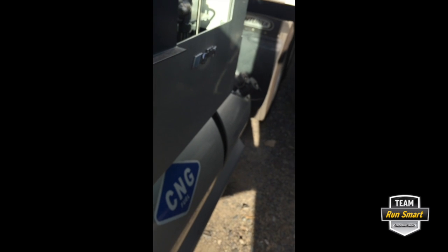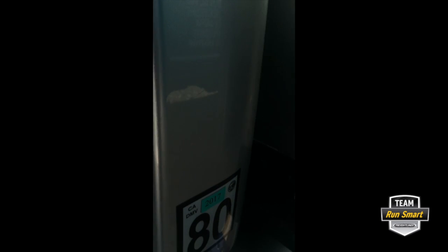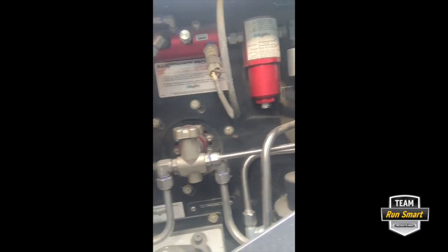We'll go ahead and make sure the system starts and everything's okay. And that, folks, is how you properly depressurize your system, check for moisture in your high pressure filter, and repressurize and start your system. If there are any questions about leaks, you may want to leak test down here with soapy water, just like you would for an air leak in your truck. Thank you very much for tuning in — I hope you enjoyed it and learned something.